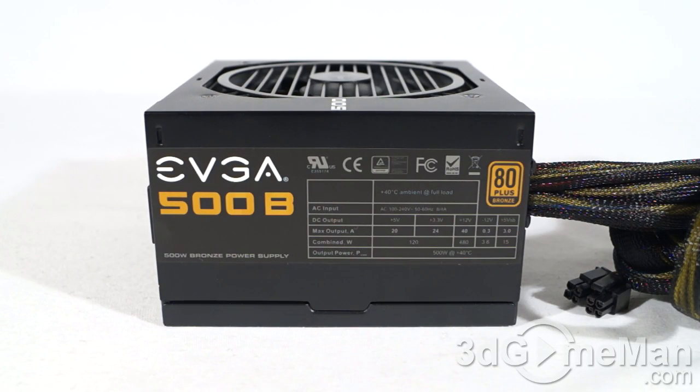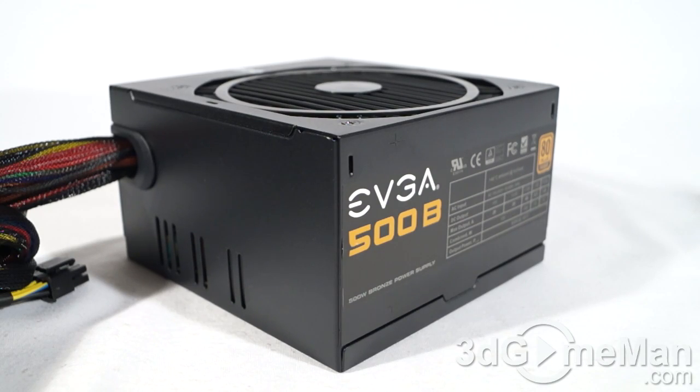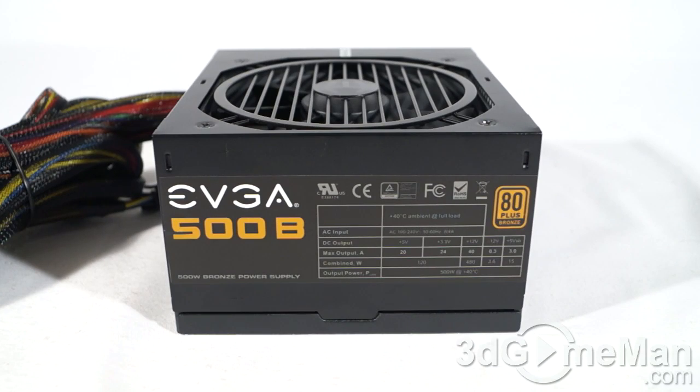For a hardcore system, select a power supply around 800 watts. If you're building an extreme gaming rig with top-of-the-line multiple video cards and lots of other hardware, select a power supply that's 1000 watts or greater. Second, it should be at or above 80% efficiency at typical load — this power supply's efficiency is 85% at typical load. Third, it should meet the latest ATX and other current standards, environmental directives, over-voltage, under-voltage, and other protections. This power supply meets all current standards.